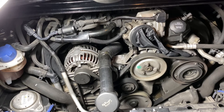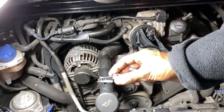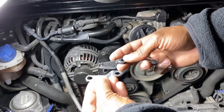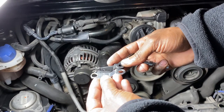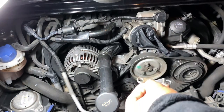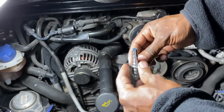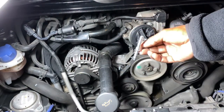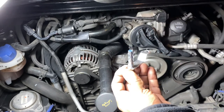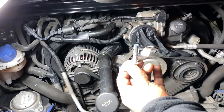That was just some loud experimentation with this part, trying to replicate what I saw on Rennlist. I realized the original piece is past its prime — there's no saving it. So what I made is this: a little piece of metal that has almost the same drop-in length as the original piece. I'm going to put it through like that to support everything and keep it from touching the belt during operation, then put holes on the bottom and top and run a screw through to hold it to the water pump.